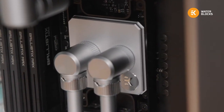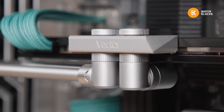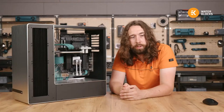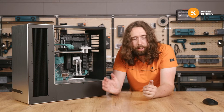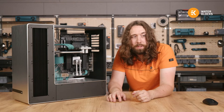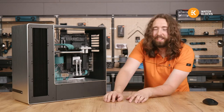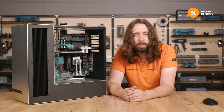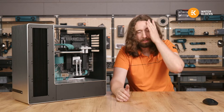If you're attempting it for the first time, definitely first watch Lutro's videos. And in addition to that, there's also a thread on the Overclock.net forum with a big list of power supply pinouts from different power supplies. If it's your first time, honestly, I would buy a power supply specifically that's easy. If you get a Silverstone with the one-to-one pinout, then for the first time you only have to make straight wires. It's going to simplify it a lot.